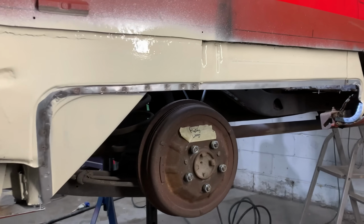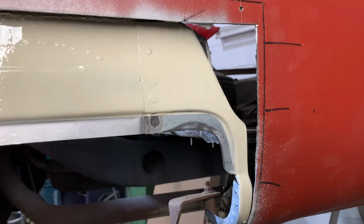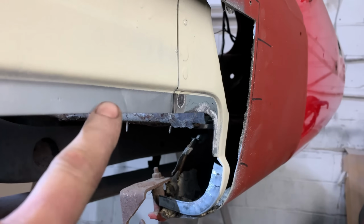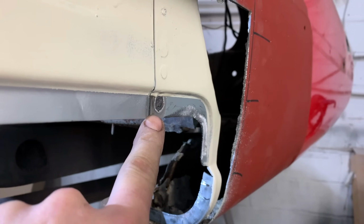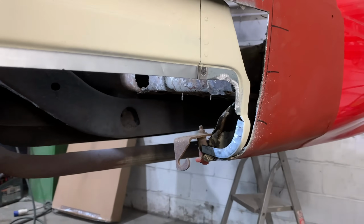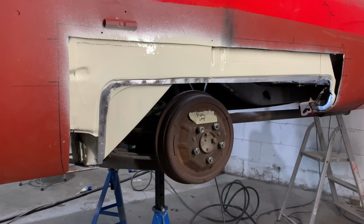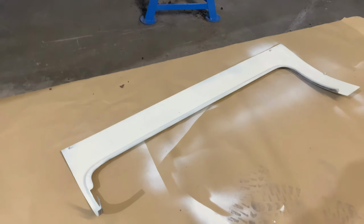Okay, moving forward, we've made up this end piece here, got that spotted into place. The joining flange here is recessed at this point, so although it's an overlapping join there, that's level all the way through. So that's in there now, ready to accept the outer panel. What we've done here, as we always do, is all the internal areas. There's a wheelarch repair panel down there.